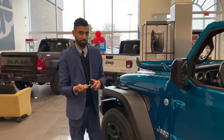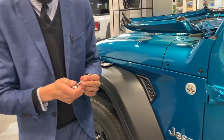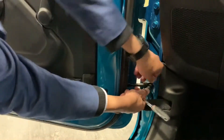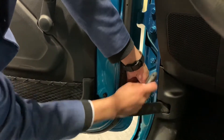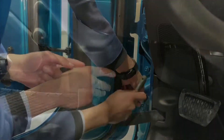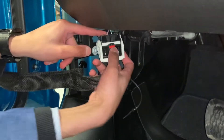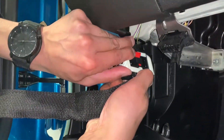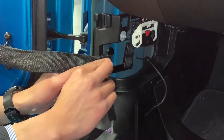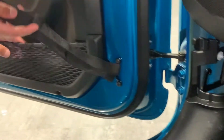I'm going to use the T-50 bit to remove the check strap inside. We're going to pull on the plastic piece, pull it off, push up on the red tab and pull up on the white. Pull it out. Lift the check strap off the hook over here, like that. And we tuck it into the door pocket.